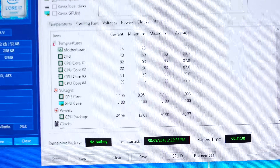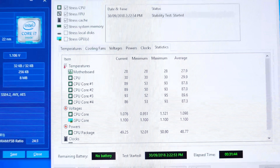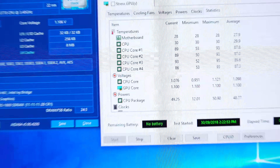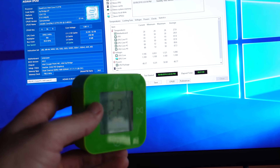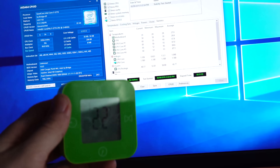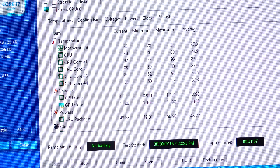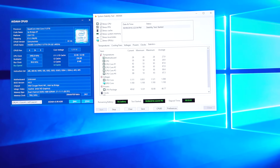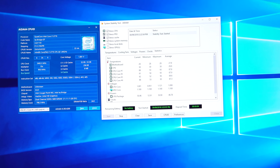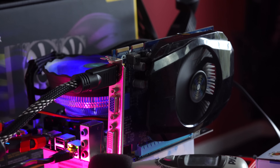After 30 minutes of testing I'm completely blown away — we haven't thermal throttled at all. Max we've hit is 95 degrees. Admittedly, it is a little bit of a cooler day, it's not summer, so in summer this thing might actually throttle. It is 22 degrees ambient. Games don't stress the CPU anywhere near like AIDA64, so what we're going to do now is load up games — especially PUBG comes to mind, a very popular title, pretty CPU intense. We do need a more powerful graphics card, but let's go.